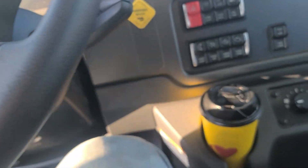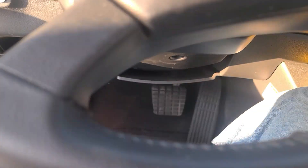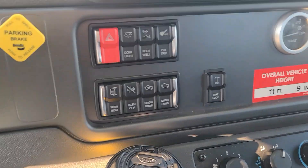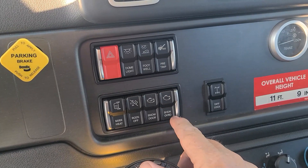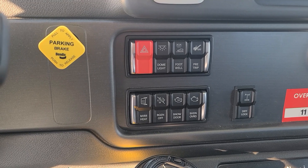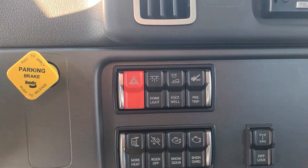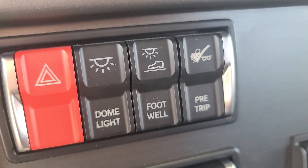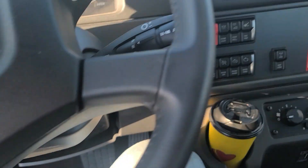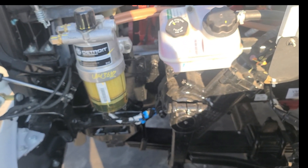Make sure your mirrors are not damaged or anything like that. I've got the headlights on — I've been driving since early this morning. On some trucks they have what they call a bulb test. This one actually says pre-trip and it's like a bulb test — it checks your lights. When you go outside, the four-ways will flash, the backup light will come on, the beeper will come on, so you don't have to keep running back and forth hitting the turn signals. You need to get your pre-trip system down and do it the same way every time so you don't forget anything.